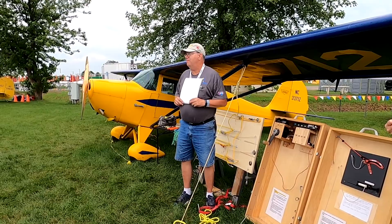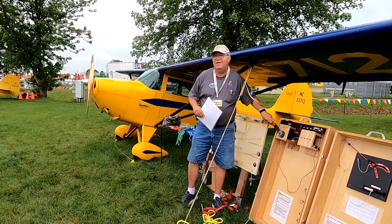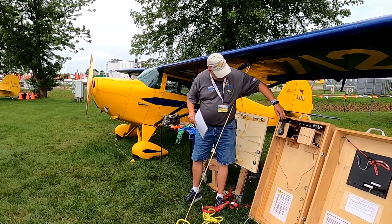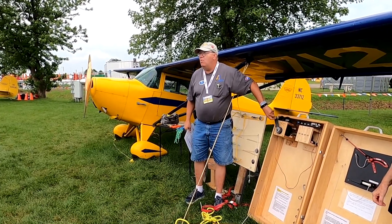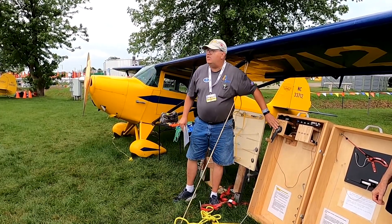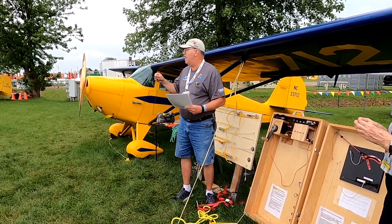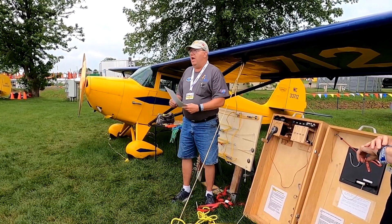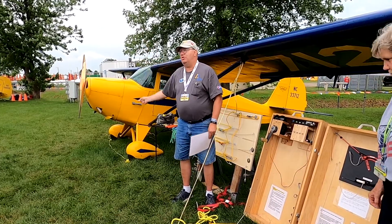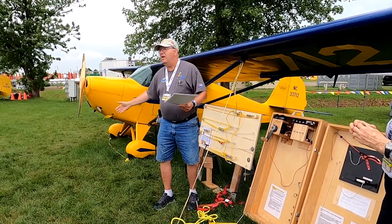How many of you have impulse couplings in your airplane? If you watch right here as I slowly turn this, that pin's not moving — that's the shaft in the middle — and we're winding it up. Whenever it gets to the release point it spins real fast, to help give you a hot spark for starting. That is retarding the spark to top dead center. So if you've got two mags, one with an impulse and one without, start on the impulse mag only — because the other one fires before top dead center. When you're only pulling it through slowly, if there's a good fuel-air charge and it fires, it might go backwards. And if you have your fingers curled over the prop, which you shouldn't, it's going to pull you in and come around and hit you in the hip or knee.